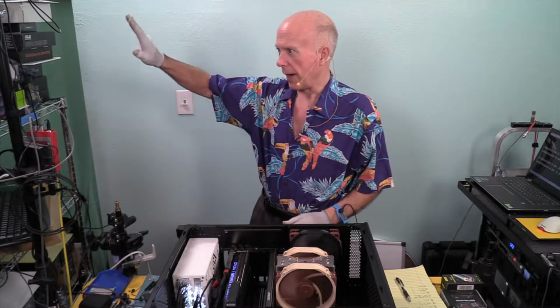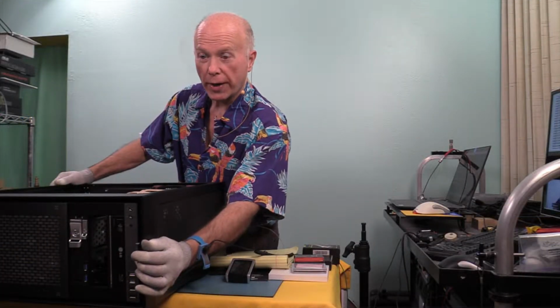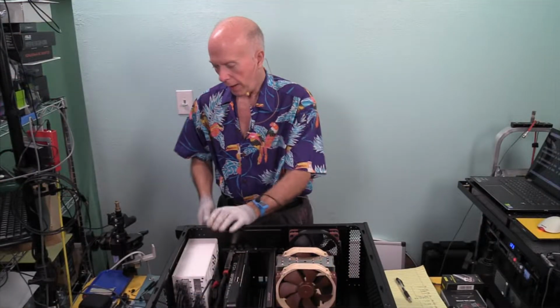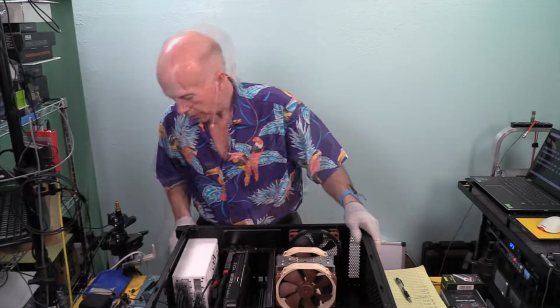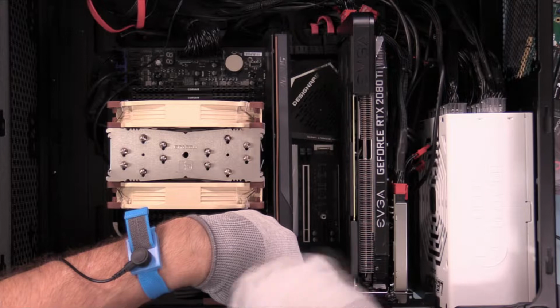So, power down, tap the power button, Windows is shutting down, turn off power, hold the switch and drain it, drained. Pull the power, capacitors are discharged, and now we got to pull the card. Open this thing up, swap 2 drives, 2 more tests.